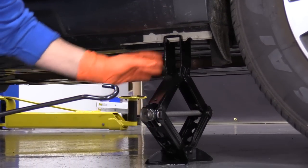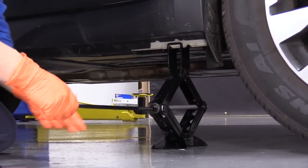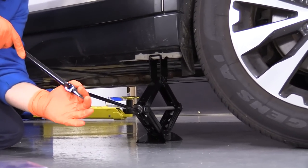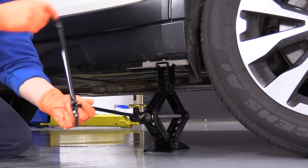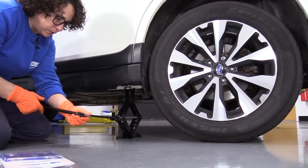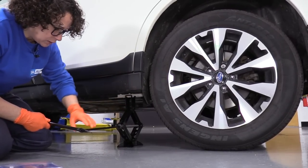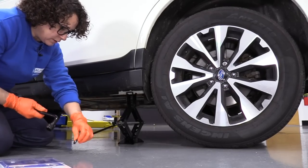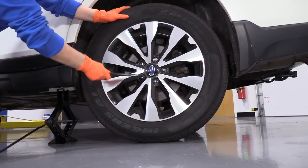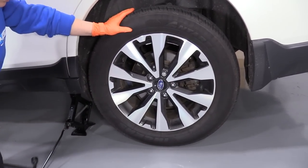So now we've got this leveled — I've got it in those two dimples and I've got it taut. I'm going to grab this hook, put it in there, grab my lug wrench, put it in the keyway slot they make for you, and just start turning it. I just want pressure on the car — I'm not lifting the tire off the ground. The reason for that is we have to break the lug nuts free. If the tire is flat and on the ground, I'm making it so there's enough tautness. A lot of people will jack the car all the way up with the tire off the ground and think they're going to break the lug nuts free — it's not going to happen.